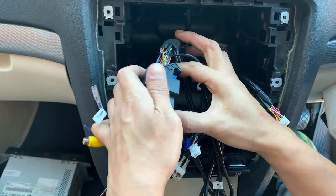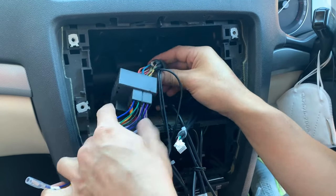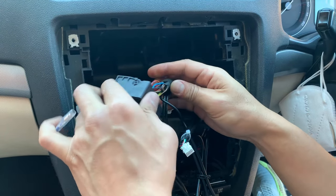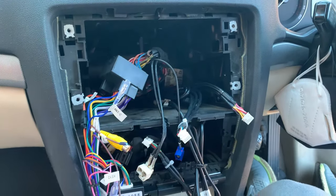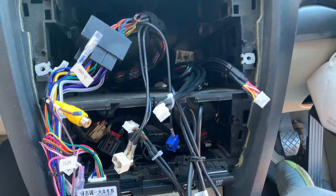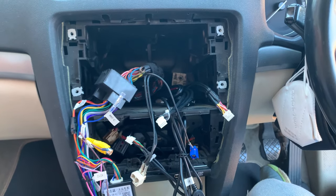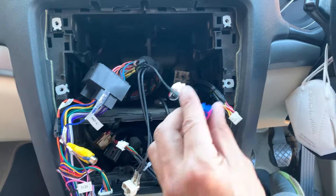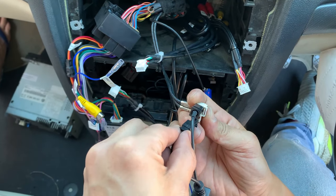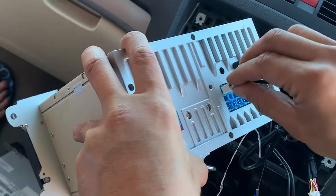The unit simply plugs in, but pay attention here: because this platform communicates over CAN bus, you're going to want to disconnect the yellow and red plug — you'll see an orange and red plug on the left hand side. Just disconnect that from its cable and the head unit will turn on and off with the ignition as it should. Next up we'll look at the GPS and antenna plugs, which was a little bit tricky — so we'll go to the head unit first and start plugging things in on the easier section.